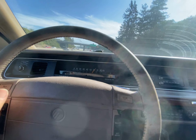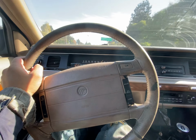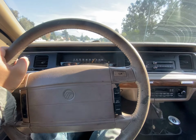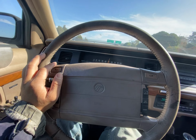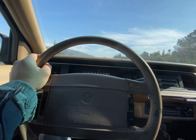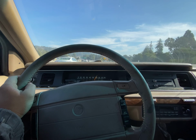Am I in like 2? You might be. Feel how it's kind of jerking right now? Yeah. Does this thing even have overdrive? Yeah, it does. Oh, something changed. The little light on the dash doesn't work, but you can feel it changing when you push the button. So this must be overdrive. So if the overdrive's working and I feel it, it's not an overdrive problem.